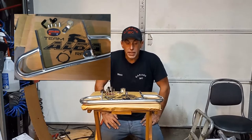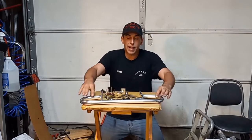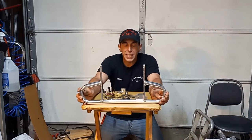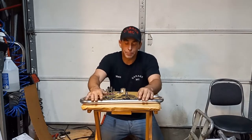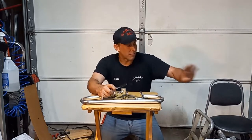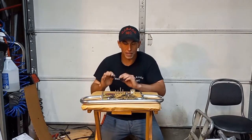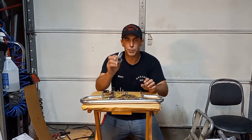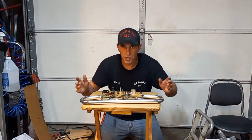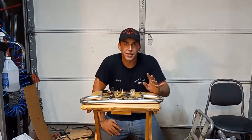In this video we are going to be installing it on our 2007 Honda TRX 450ER. This grab bar fits all years of the TRX 450R and 450ER. Tools you will need: a 10mm to remove your old grab bar, and the new hardware and mounting brackets that come with the grab bar from Team Alba Racing are 12mm. It also comes with the exhaust bracket, any brackets you may need for mounting a light or a flag if you're going to the dunes, and a mounting bracket for a number plate if you desire.